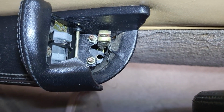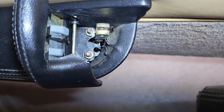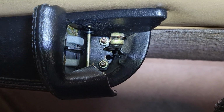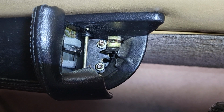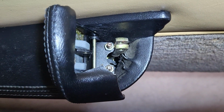All right, the first step was to release the clevis pin, and then the second was to get it off the perch, and you can see the cable with the hole and the travel slot forward that is to the right. We've now separated the cable from its holder, and the bolster is free to be removed with the door card. So our second of our 4 steps is earned.